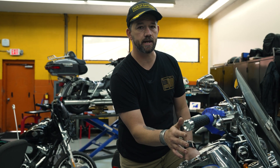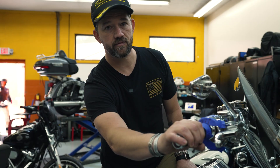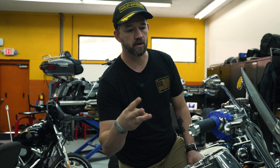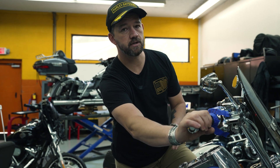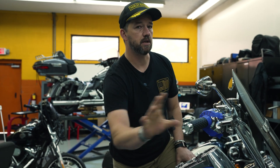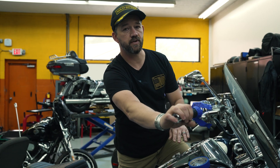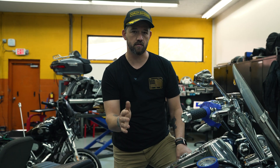Let the bike coast back down. Then you're going to go from quarter to half — bring it up from 1,500 RPM to 4,000 RPM, let off, let it decelerate back down to 1,500 RPM. Third one, three-quarter throttle from 1,500 up to 4,000 RPM, let off. And your fourth and final one, come down to 1,500 RPM, take your throttle position to wide open, go from 1,500 to 4,000 RPM, and let off and decelerate.